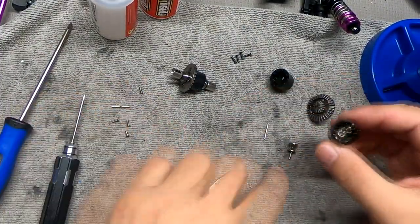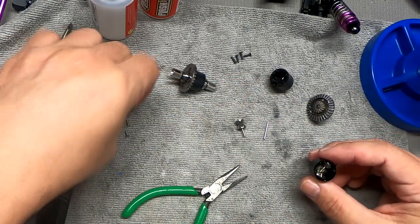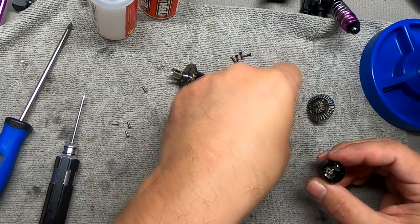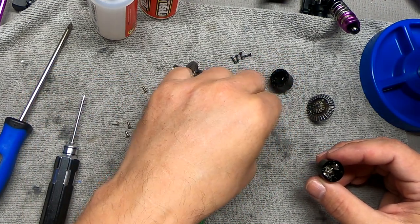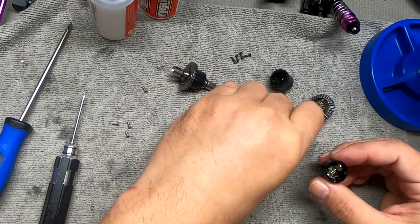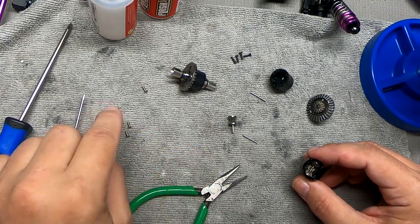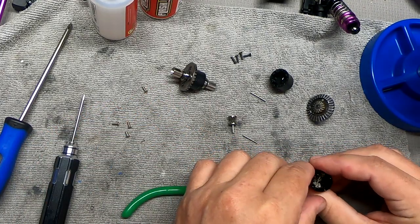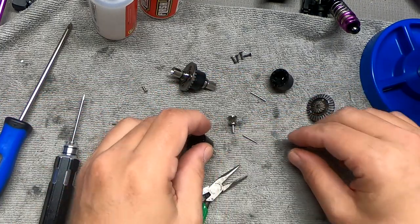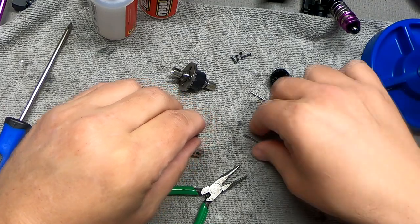Okay, remember I said I was just going to drop the gears in as they were? No can do. The shafts that they provide are slightly shorter with the aluminum case. It's only a couple millimeters, but it's enough that the ones that come with the plastic will not fit. So make sure you use the ones that come with the aluminum case. Otherwise, everything is the same. They got the same notches. So it's easy enough. Just swap the gears over.